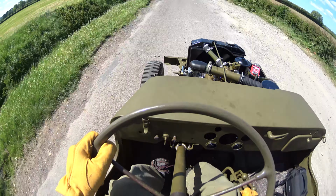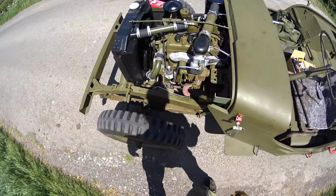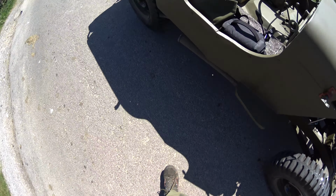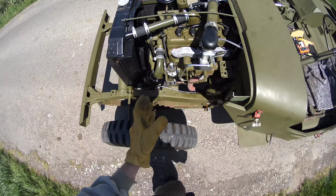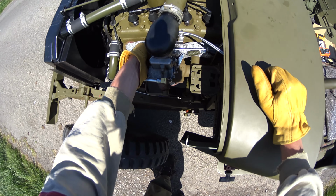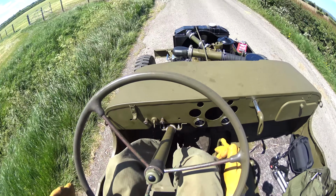Let's come to a stop and then just see how the engine idles from driving. So there you go. So we've just been driving. So it's not, you know, sputtering. Not sputtering or doing anything weird straight away from going from hot driving to just suddenly stopping. So that's really nice. The engine is really sweet. I mean, see, the carb's still got a bit of hesitation there. I think it's the acceleration pump. It's fine once it gets past that first bit, so I might have to have a little play with it. But you can't really notice, but...